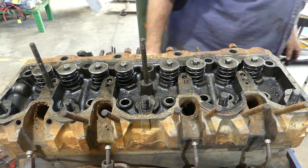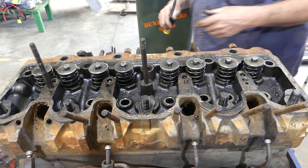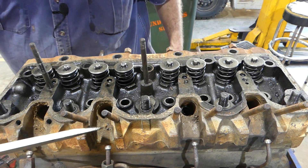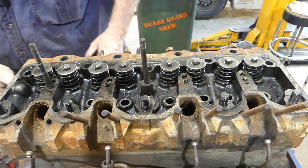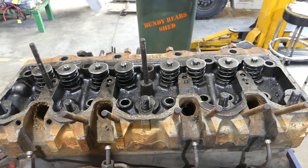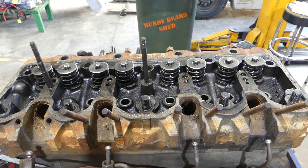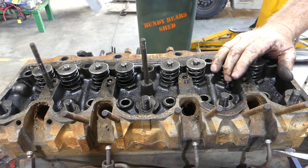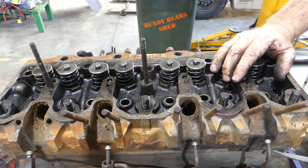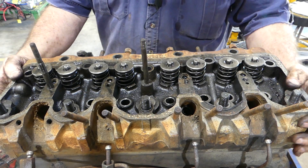That's tight — that's a good thing. We don't want to go chiseling in here with a screwdriver or anything like that. We want to find a place where we can get a little bit of purchase on the cylinder head, like there, and help give it a little lift. I'll try the same around the back.